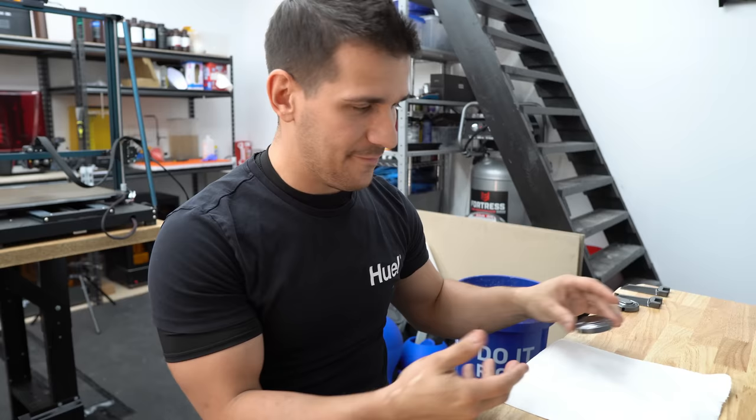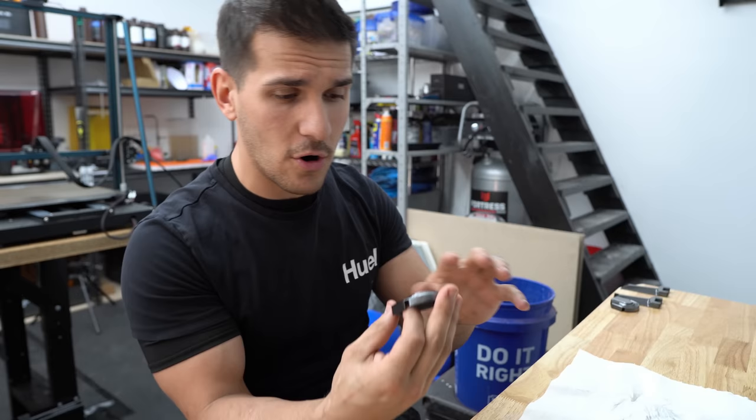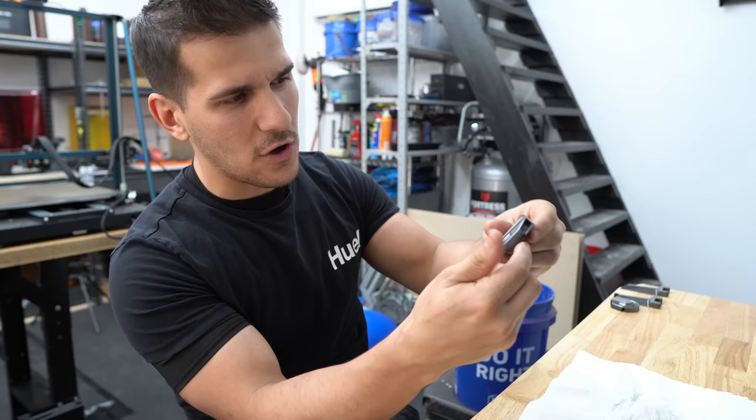All right, all done. As for protecting the graphite rub, you don't need to, or at least I never have. As long as you wipe everything down really nice at the end there, just wipe it down with a cloth or a rag. That's it. Look, nothing came off. I had already wiped it down once, and I can touch this. I can get my fingers all over it, and it's not coming off. Like, it stays on. You're actually pushing the graphite flakes into the clear coat and paint. It's permanently staining it.